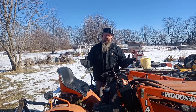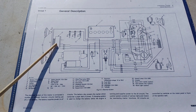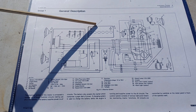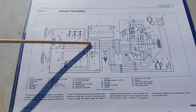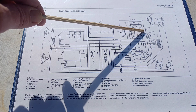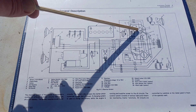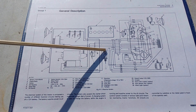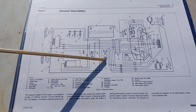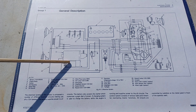I'm going to try to diagnose this starter system from the battery all the way to the solenoid. We'll figure out exactly what's going on here, and that way if we need to order anything we don't just willy-nilly buy parts we didn't need. Okay, best place to start a job like this is in the electrical schematics. We got the battery here — positive power comes off the battery, goes to the main lug at the starter, also branches off. A red wire comes up through the harness connector, comes into the switch at terminal number 30 on the back. When the switch is in the start position it powers terminal number 50, comes down on a black and white wire, has a disconnect, goes to the safety switch. If the safety switch is activated, it sends out power to the switch side of the starter solenoid.